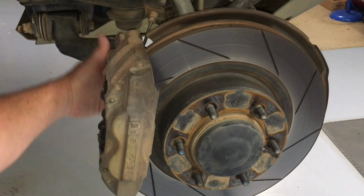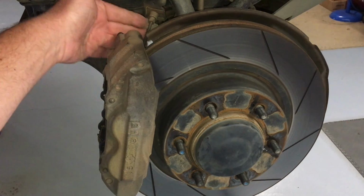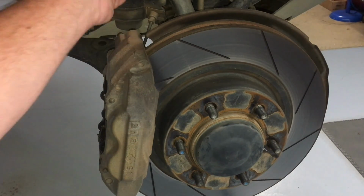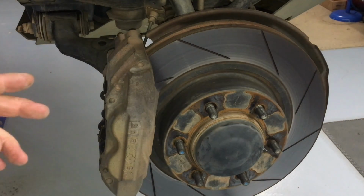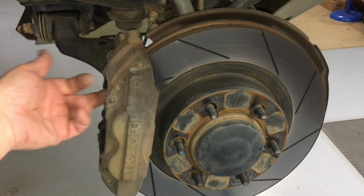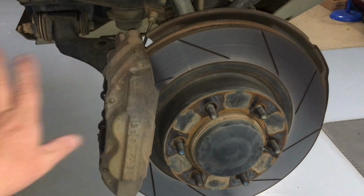But look, 19mm behind there, the two big main ones that go in, and unbolt this whole assembly and don't let it go, because then this brake line here will get bent around and nearly snapped, and if it doesn't snap, it might snap with some vibration out on a track one day. Very dangerous. So make sure you've got some tie wire handy to tie up this caliper. Those brackets out first, those bolts off, have your wire somewhere handy, or you can use an Oki strap if you want, and have it tied up somewhere on the body of the vehicle. Find a hole where you can hook the wire through, then hook it through the caliper just underneath and out the other side, give it a twist and tie it up over here somewhere, and it's completely out of the way, right?